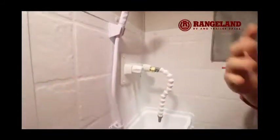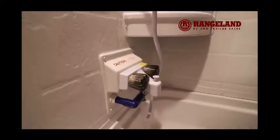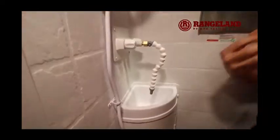And then one of the amazing features, and you don't commonly see this in a lot of comparables in the market, is this AquaView shower miser. Now, you can see that L bracket there is blue. What that's going to do is, when you want to have a shower, you turn the water on, and it pulls the water from your hot water tank and bypasses it right back into it until the water heats up. When that water heats up, that L bracket's going to turn white. You turn the bypass valve back on, and it's only hot water that's coming out of there, and only that water goes into your gray tank, whereas in the traditional way, all of that water you're waiting on until it gets hot goes right into your gray tank. So it's definitely going to make sure that you're utilizing water efficiently.